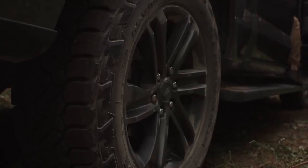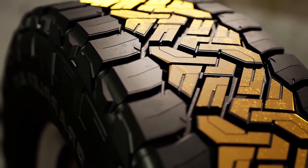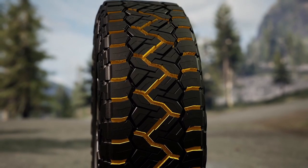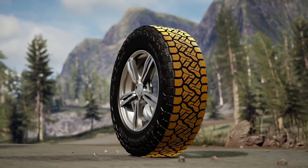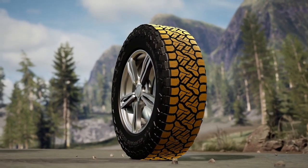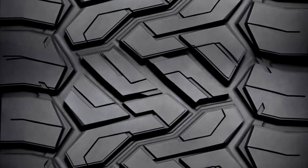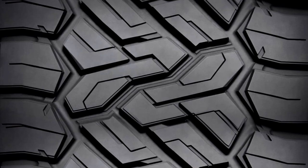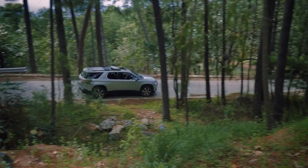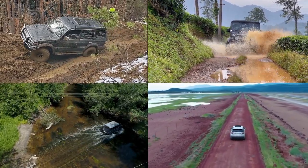Since the tire's shoulders come into play on corners, the Recon with its minimal shoulder design provides good on-road grip but suffers a little on wet roads. However, the central area of the tire is totally different — separated by wide circumferential channels and showing a versatile tread pattern with a combination of sharp lateral grooves and a mixture of wide and narrow siping. The blocks form a somewhat triangular-shaped pattern and make zigzag lateral grooves which join the outer channels, all providing a decent path for water, dirt, and mud to pass through.